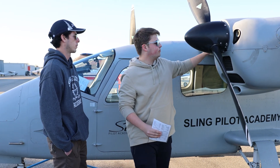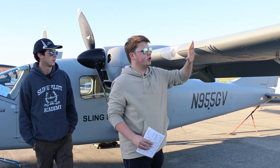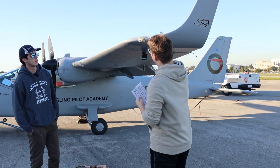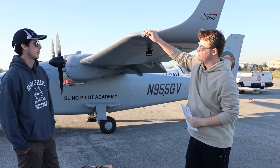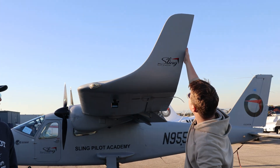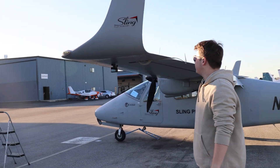From there, I always do my basic walk along the leading edge of the aircraft, double-checking for no major dents, nothing that was damaged from the flight before. Everything looks good there. Our light — we already checked it earlier, but I always like to double-check that it's secure and give it a little shake. And same kind of thing, we're going to check the condition of our winglet here. Make sure everything looks good.